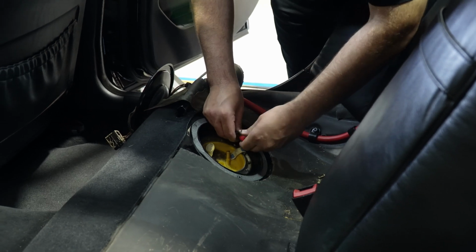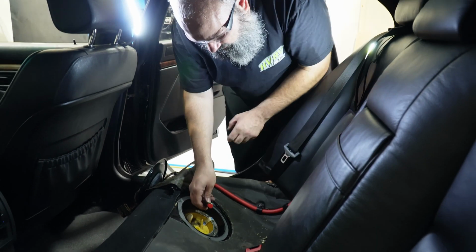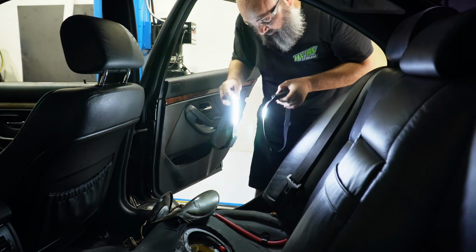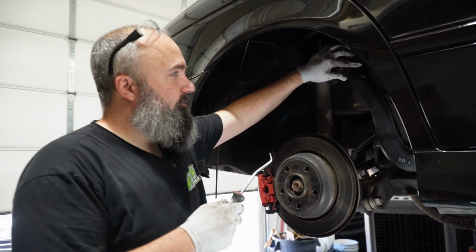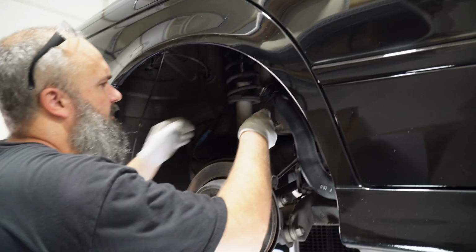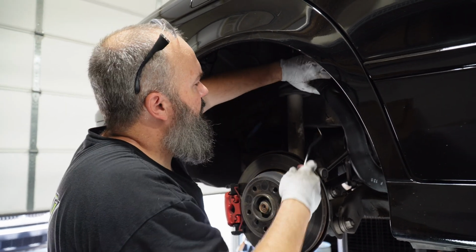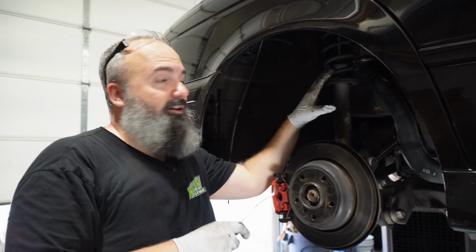And so we don't get fuel dripping in our face, I'm putting some powder coating silicone plugs in the fuel lines, to help protect our eyeballs a little bit. We're going to do the same thing here at the fuel filler hose. We're going to try to get a pick in underneath, spray a little WD in there, and then run that around the outside. That'll get our line nice and loose, really easy to come off.